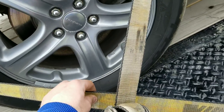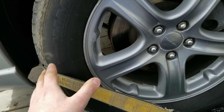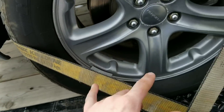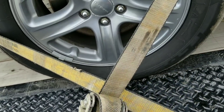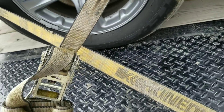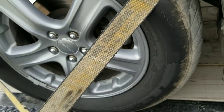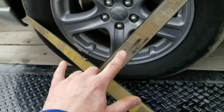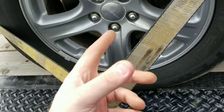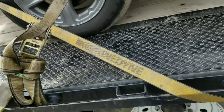Twist these, interlock them - so the way it would go is I would have a strap go through here, come out, and then loop it around this strap so you got this looping effect. If you guys go back on my video where you could see my Mercedes and the Cadillac being towed, look carefully on one of the sides of the cars - they're like this - and the other side they're interlocked. My buddy was helping me, so he ended up doing it like this and I did the interlock thing, and at the end of the day he said 'oh now I get it, why you do that.' The interlock does two things: slim chances the strap's gonna go anywhere, and it evens out the tension on both straps. This setup without the interlock puts a lot of stress on one side and pulls the wheel out.